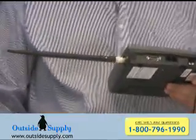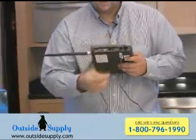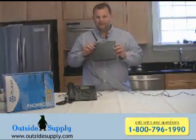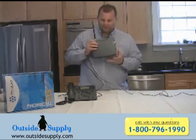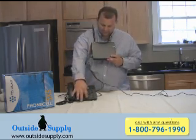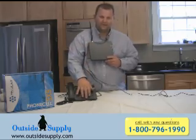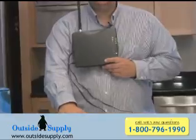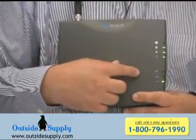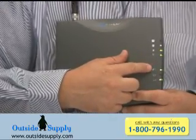So one of the things we also want to do is go ahead and plug in our standard desk phone. We'll plug this in and we'll have this cellular unit working. Now, because no one's on the phone, we don't have anything lit on the off-hook indicator. If we go ahead and take this phone off hook by pressing speaker phone, you'll notice that the off-hook indicator will go ahead and come on. I just put the phone on speaker phone, so you'll notice that the off-hook indicator has come on, and that will show you that you're ready to make a call.